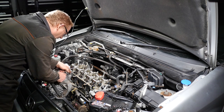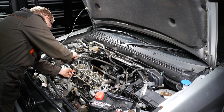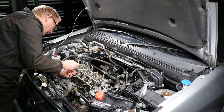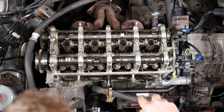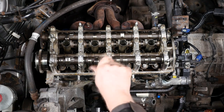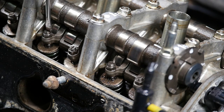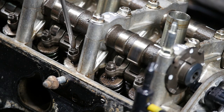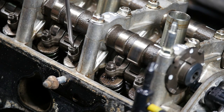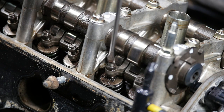I tried to undo these with a short 10mm spanner and that was quite a struggle, so I'm using a longer 10mm spanner here which gives a little bit more leverage. Then it's just a case of undoing the screws with a flat-bladed screwdriver — just turn them to unlock and then unscrew each one in turn. We need to do that to take all the pressure off the intake camshaft. There's a close-up view of it — you can see the valve rising there, and you can clearly see the intake cam primary and secondary follower.